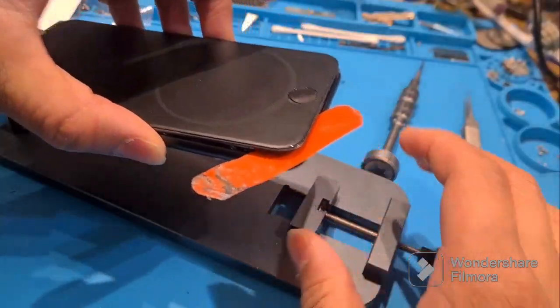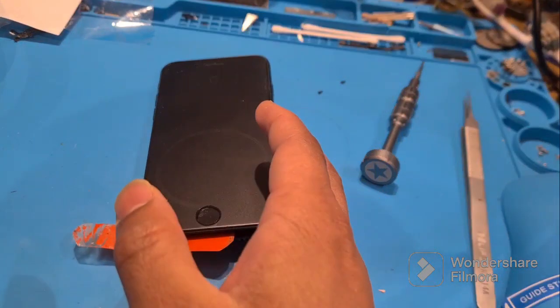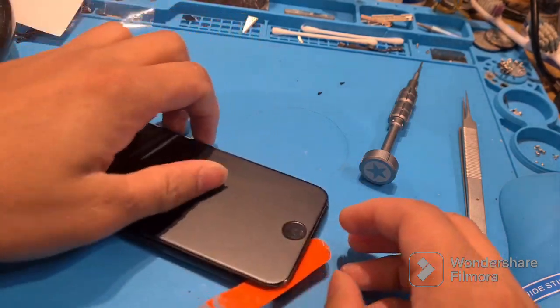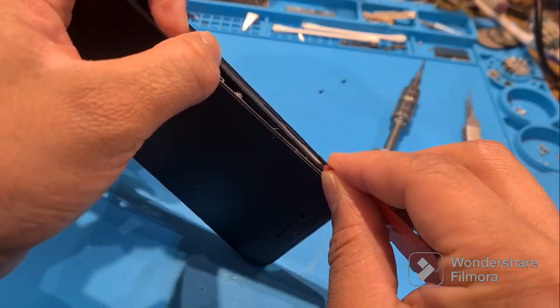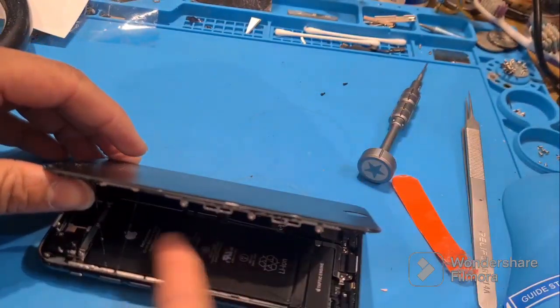The second type of black screen is my case — I tried everything: force restart, charging cable, iTunes, 3uTools — nothing worked. So now you need to either open the phone, or wait one to two days for the battery to fully drain. After that you can charge it again and it should come out of the black screen.